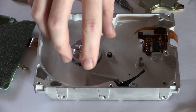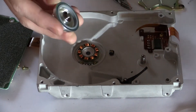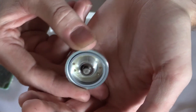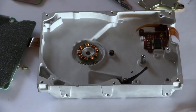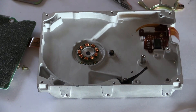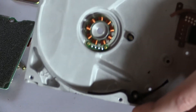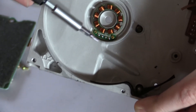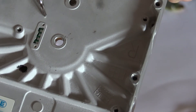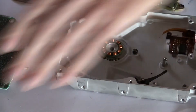After a few hits with the hammer we can pop the lid off, and it is embedded to the case really. So what we have here is kind of only the flywheel with the magnets on it. And what's left on the case is the coils and the connector. The connector goes through the board to the other side.